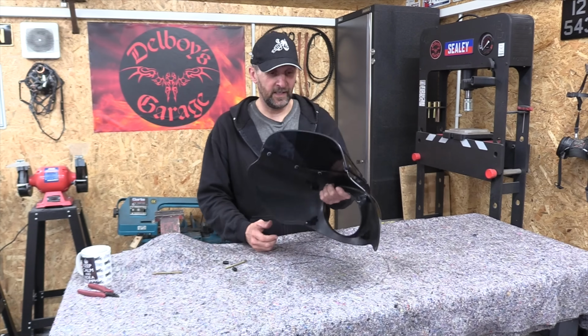Right, here's something I'm sure you know, but it's always worth saying. A couple of split nuts will crush down onto the thread and they'll hold it still in the vise without damaging it. And also, if you put the second split nut where you want to cut, so it's exactly the right length, you cut up against the nut, then you get a perfectly straight cut every time. And also the best bit, when you unscrew that nut afterwards, it cleans up the thread so it fits in the hole.